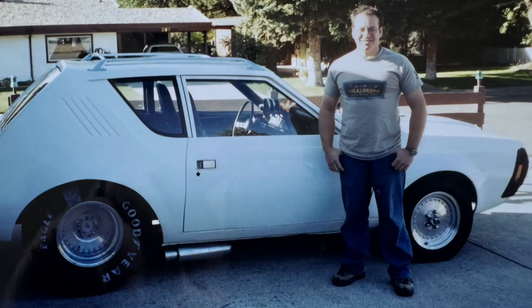The nice thing about the three-wire alternator is that if you have a dash light, you're going to see it come on. My experience with that: I used to race a Gremlin with a small block Chevy in it. I'd go down the racetrack, buzz it to high RPMs, and flip the belt off all the time. When my alternator light came on — it was brighter than my shift light — I knew I'd lost my alternator belt. That meant I could shut it off at the end of the track, because by the time I got back to the pits I'd be overheating. I hope this helped you make some decisions on what kind of alternator you want.